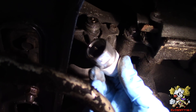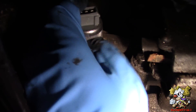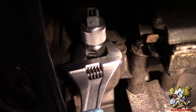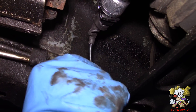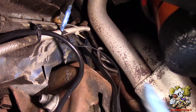They supply you this with the kit — it converts the mechanical signal to an electrical signal. Just put this in the hole and turn that on there, and we're good. Now put the wire supplied in the kit on. We're just going to zip tie these here and follow these rails up. We're routing it through where the old speedometer cable went, through there, so we're just going to pull it up in there.